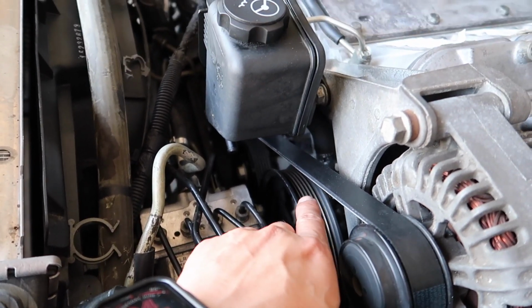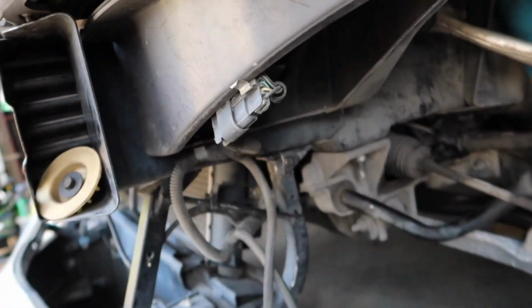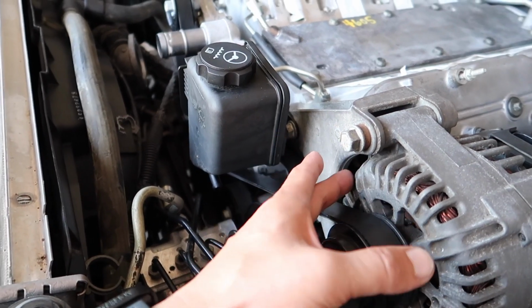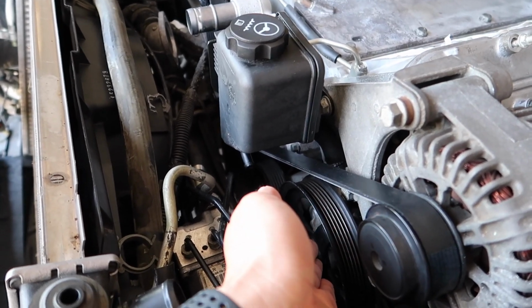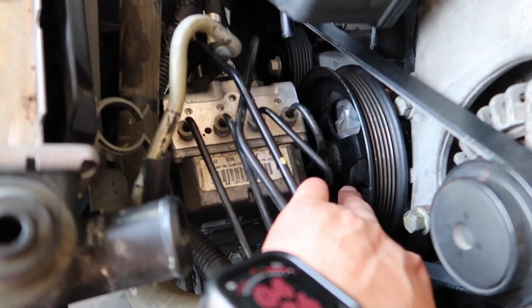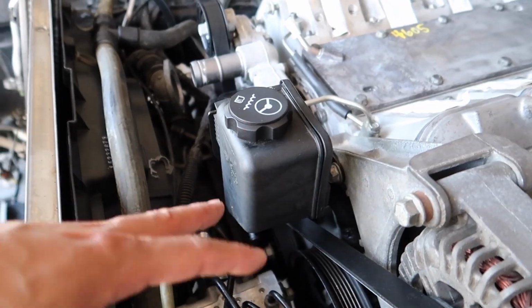And then before actually getting the subframe back up, so if you notice, subframe's already attached. Before raising the subframe back up, I made my way into installing the bracket first with the pump right in front of it, and then putting the pump in. The pump is actually held on by 3 bolts in the bracket here. So doing that before actually raising the subframe, it'll make your life a lot easier.